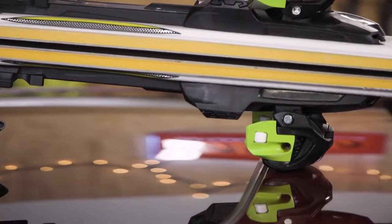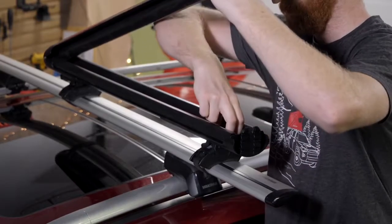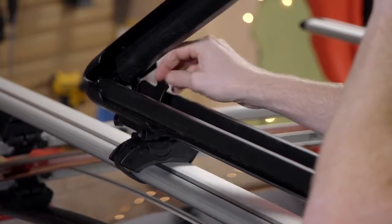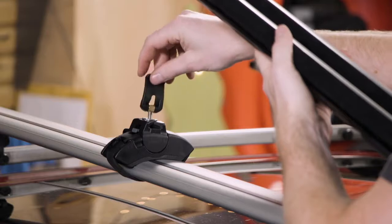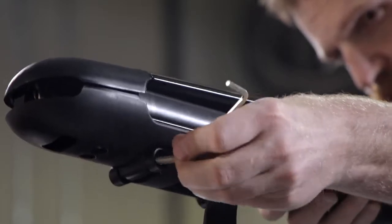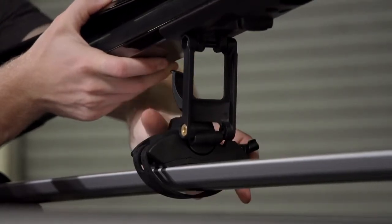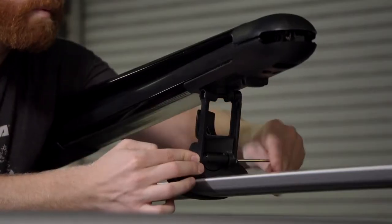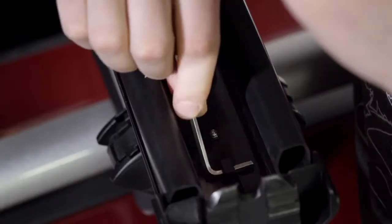If your bindings are hitting your vehicle's roof, you need to use the included ski lift. Loosen, but don't remove, the knob next to the opening. Then loosen and do remove the knob near the hinge. Lift the mount off the screw and reattach the knob — don't fully tighten it. Remove the ski lift screw from the bottom of the mount and swing the ski lift down. Slide the clamp into position under the ski lift, aligning the holes. Close the knob and install the ski lift screw through the lift and the clamp. Retighten and close the other knob near the opening, and stow the wrench away.